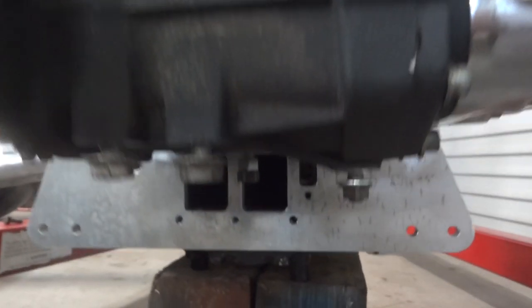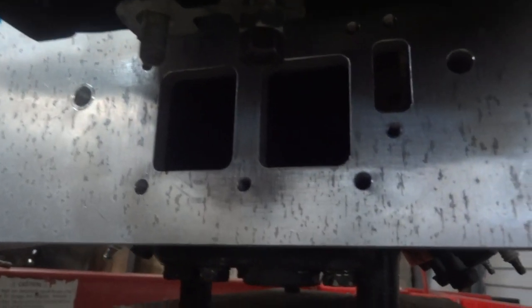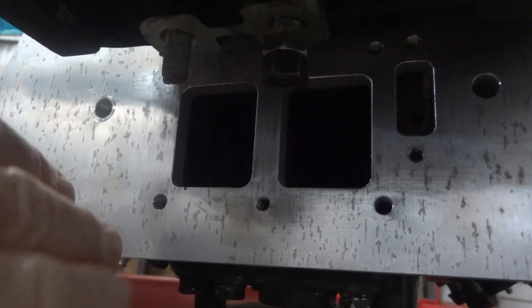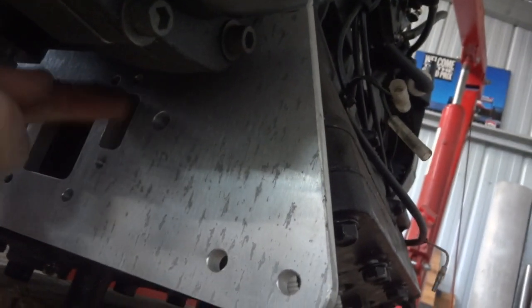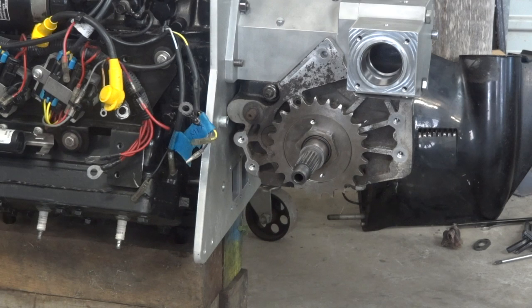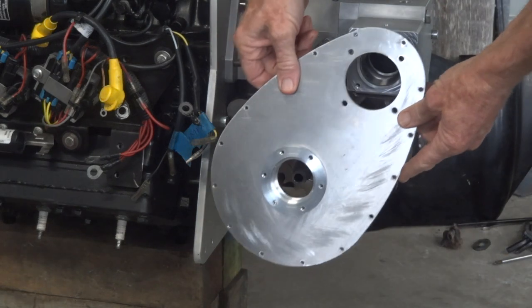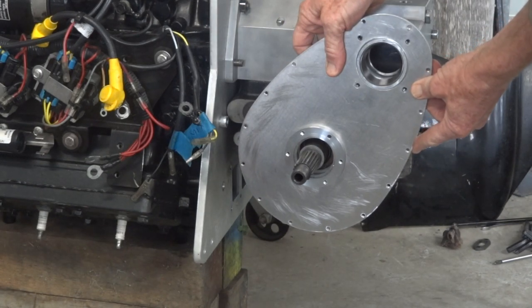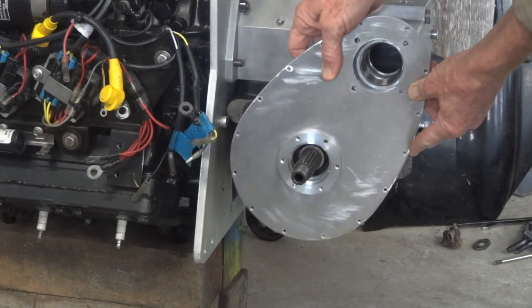Having a little look around underneath here, there's just about room for the exhaust to come out underneath the gearbox — we'll get rid of those two little studs, I think that'll work out alright. And you can see the water outlet there tucked up behind the gearbox; we need to make a pipe to bring that out the side, which we'll do shortly. This is the secondary drive chain back plate, which looks like it's going to fit on quite nicely just there — some more detail about that later.